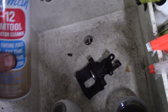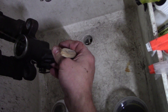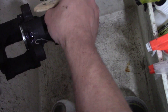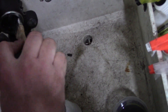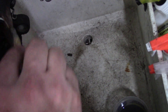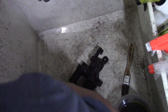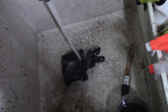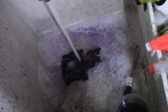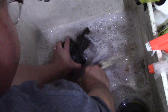There is a kit you can get that's got new spring, new pad springs, new boots and caps, if you want to put new ones in. These were in pretty good shape — I bought a new kit anyway but I did reuse some of the old ones. A little Berryman's B-12 Chemtool to dissolve some of that grease, and we're going to do a hot bath with a little Super Clean here in the wash sink — one of the best things I think I ever put in the garage when I had the house built.